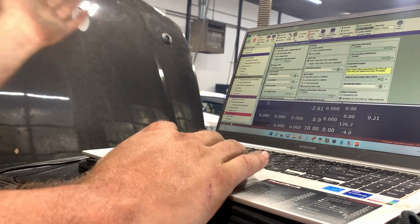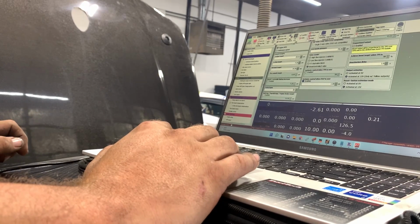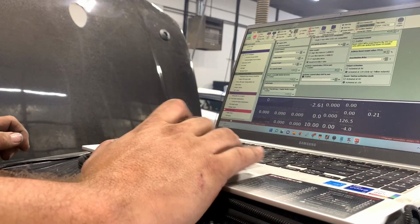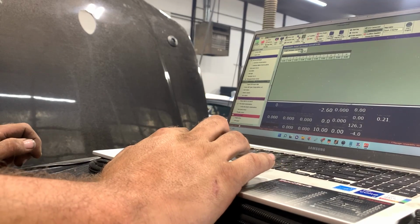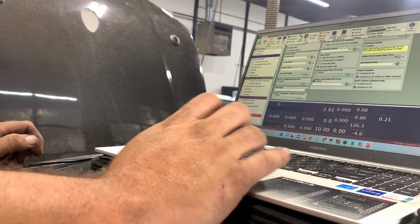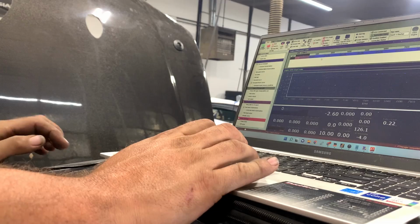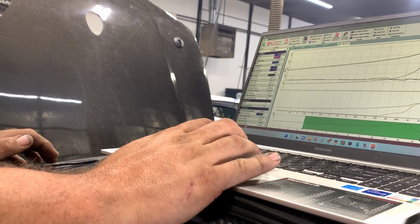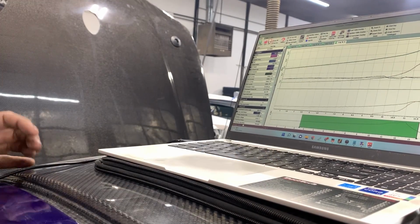See, it doesn't show me anywhere to put wastegate pressure, you know what I mean? And it is set to 75. Wastegate target pressure overall trim. Yeah, it is set to 75. I was targeting 25, and we made 32. Ooh. 33. So a 7 pound difference.